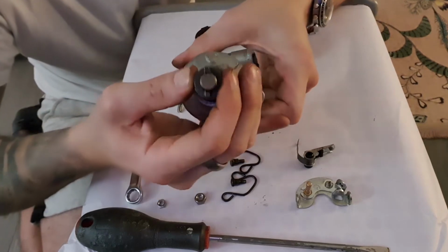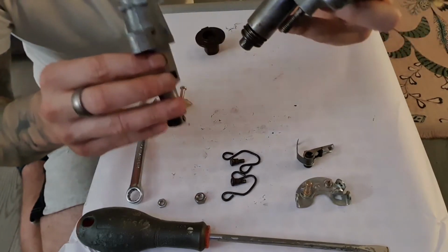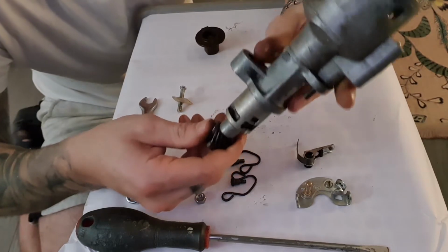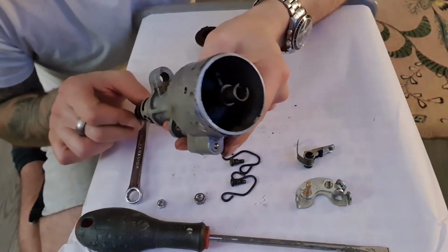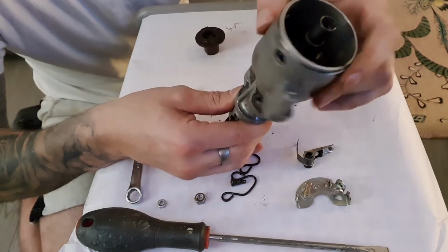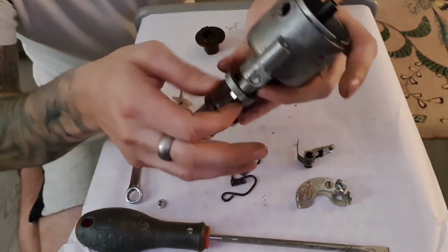And it really just acts to stop that peg from flying out. So what we have now is the top part of the distributor sorted, and we can install it onto the bottom half, and it just sits in there like that. Now it doesn't quite fit in place until you give that a little rotate, and that drives it into the peg. So if I spin that now, you can see the top is moving and being driven. And there is a bit of movement here, which is how you actually set your advance timing, because it's adjustable depending on the orientation in which you install the distributor.